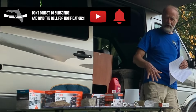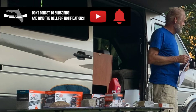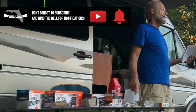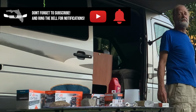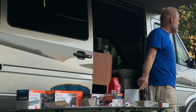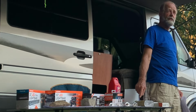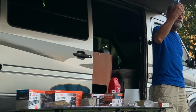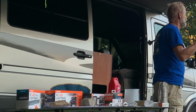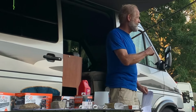Sylvania offers a range at different price points, and indeed they have a wider color range as you go up the scale. They have more output. The downside is you can never defeat the laws of famous dead guys. It's all physics. If you push a filament harder, it will die sooner. So you need to make a choice. Do I want a headlight that's going to last a couple years? Or do I want one that's going to last maybe only 1 year, but give me 20 or 30% more light on the road? I'm going to say I want to see better than that, and they're not that hard to change in here.